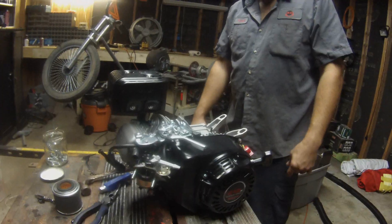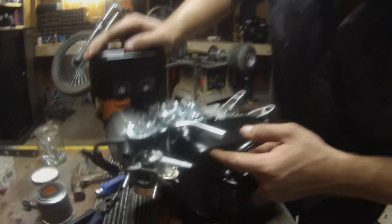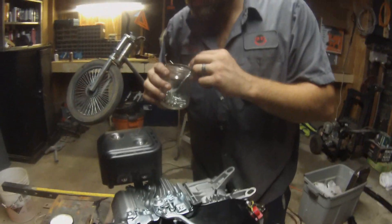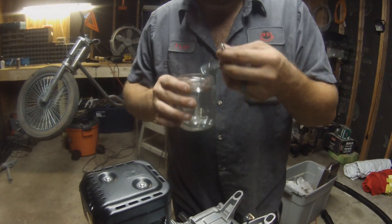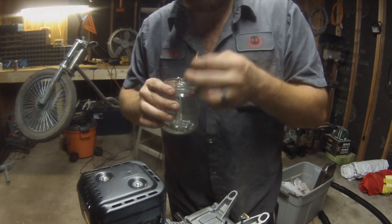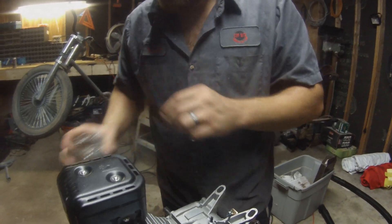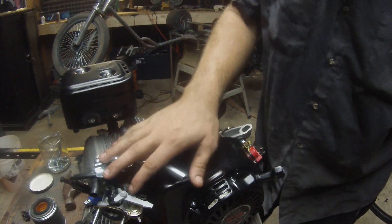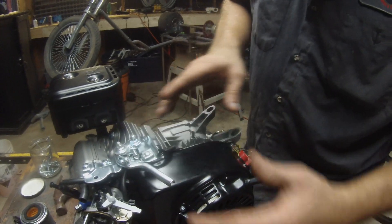The governor arm is removed. So we've got both springs off, both rods off. Just a tip, guys — you're probably never going to use this again, but you never know when you might make something out of that. We're going to use that spring here in a minute to help as the return spring for the throttle. Okay, all that's removed — that's all we're going to do right there for right now. We'll come back to this a little bit later setting your throttle up.